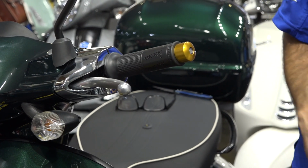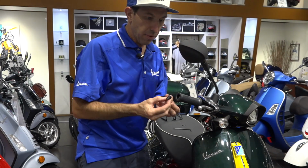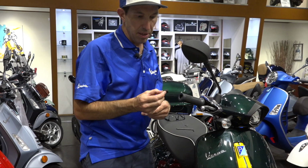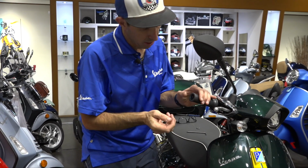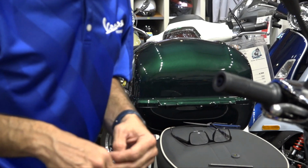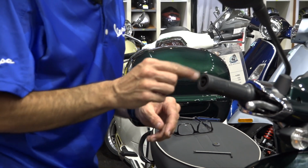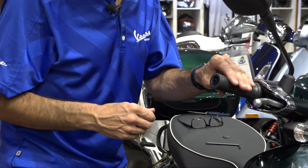It's a little more critical on the setup, on installation. You probably have the remnant of the cut spacer from your left side. It happens to be pretty close to the right length, and it goes right in there, no problem. So I think we'll try using that and use a combination of washers and the Rizoma spacer and get this side set up. It's very critical not to have the bar end touch the grip. Otherwise, you end up with a cruise control that may be unwanted.